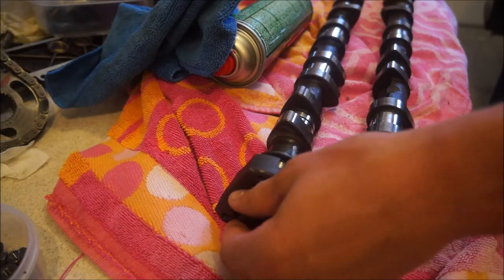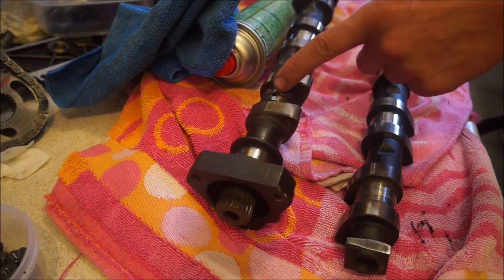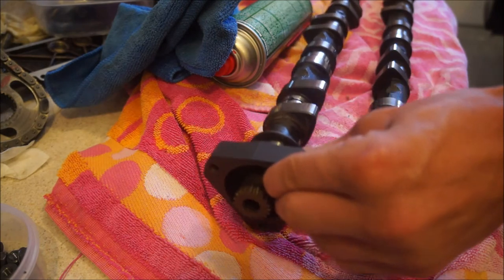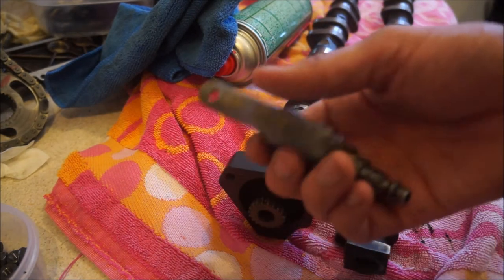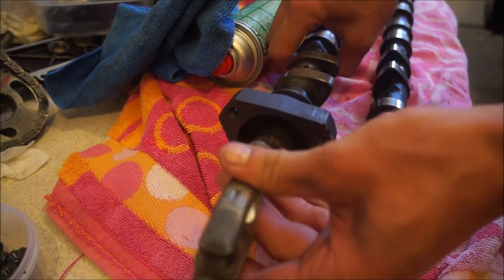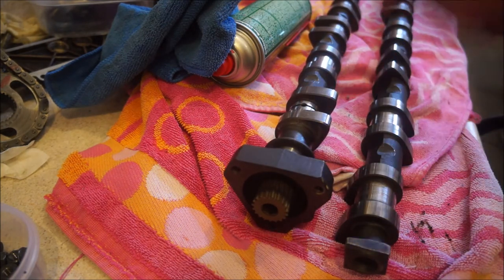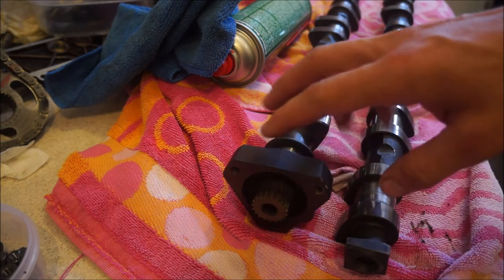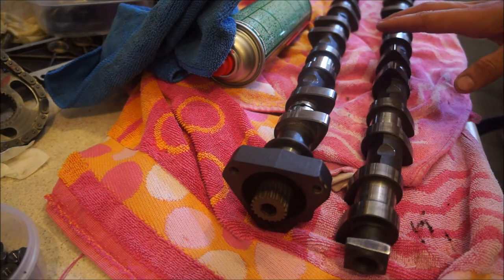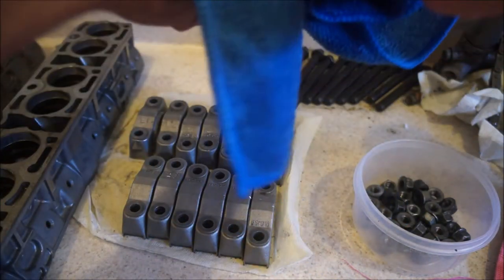Another thing with the intake camshaft — you'll see that little hole on that bearing journal. That's actually an oil channel that runs from that hole into the center of the cam and then pops out on the intake side. Sometimes old oil will collect in there and it can get clogged. What you can do is take an airline attachment, stick that into the end of the cam, and blow compressed air through that little passage — blow from that side too — just to get some of the old gunk out. If this is the first time the cam has been out in 15 or 20 years, there's probably going to be some old oil and gunk inside there, so it's a good idea to blow that out as well as clean the rest of the lobes and journals.